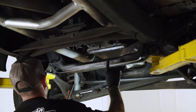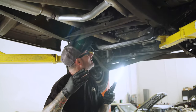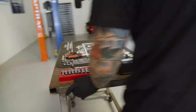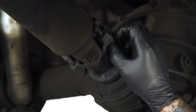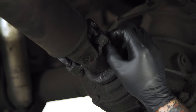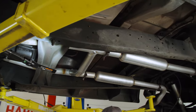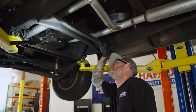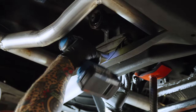The crossmember is riveted in, so if worse comes to worse I'll cut it at the crossover so I can get one side out and weld it back up. We'll throw a rag down when I pull the drive shaft out since it'll probably leak some oil. We'll definitely need to get a new drive shaft made - different tail shaft on the GM transmission, and it's probably going to be a little longer - so we'll run up to our local drive shaft shop. Let me get a pole jack in here to hold the transmission up so we can get the mount and crossmember out.